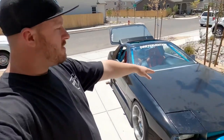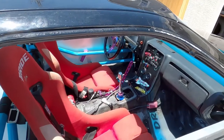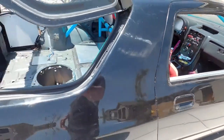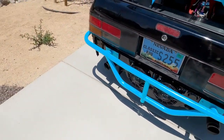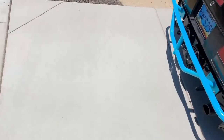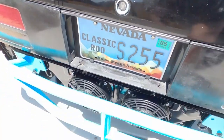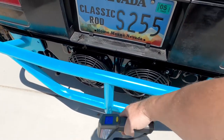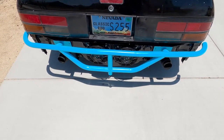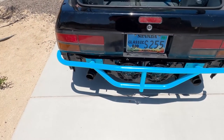So in an attempt to get it to raise the temperature, because it got up to about 180 and would not move off of that number, I unplugged the radiator and then put the hood back on it. We'll see. It's starting to go up a little bit, 189. Should be kicking on soon. There's probably a temperature difference from the front to the rear. Wow. All right, well, they came on. So the temp gauge says it's 210, so that's when they're coming on. The temp gauge is not really accurate, but we'll see if it's enough to maybe just maintain temperature